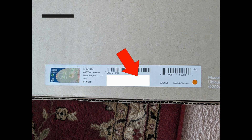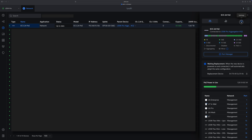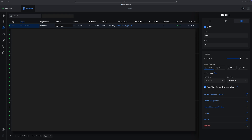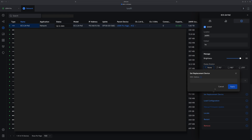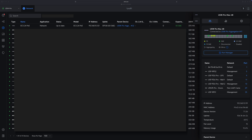From the packaging of the RMA replacement item, you can find a label where you will see the MAC address for your replacement device. Then, in the UniFi Network controller, while your old device is still connected and showing green, go to Settings and click on 'Set Replacement Device.' Input the MAC address from the packaging of your replacement item, then click Apply.